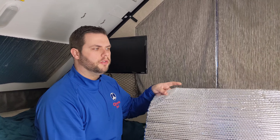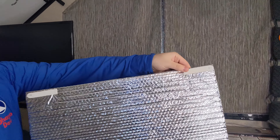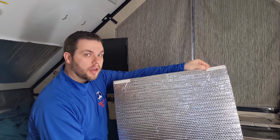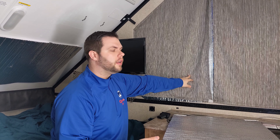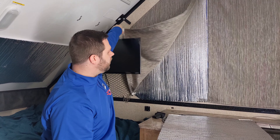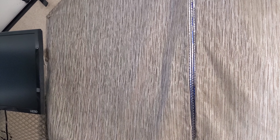This one is for insulation that we've added to all of the windows. They're just held on by simple velcro command strips. We did this because a lot of times we'll camp in very hot climates where the sun is very strong, and this helps reflect a lot of that heat — because these walls on this camper aren't very thick, but this stuff makes a world of difference. We've got it lined on basically all of the windows. Another advantage this reflective insulation gives is it blocks a lot of the light, so if you really want to sleep in, you can.